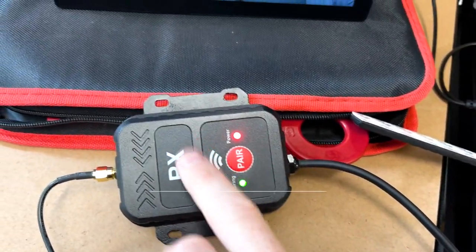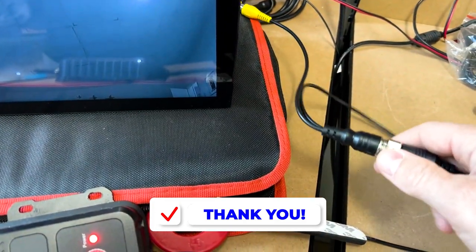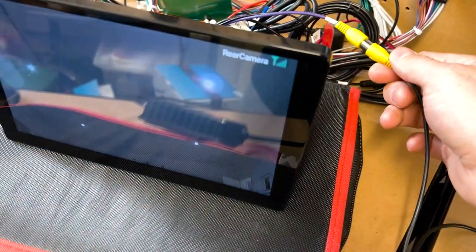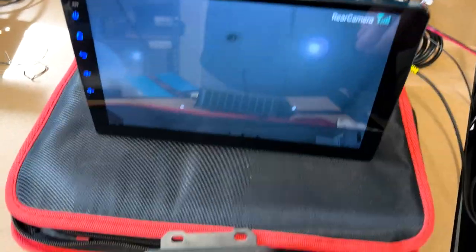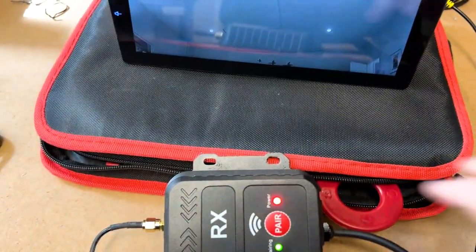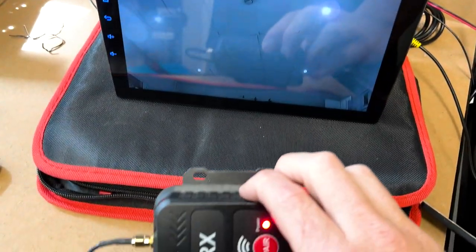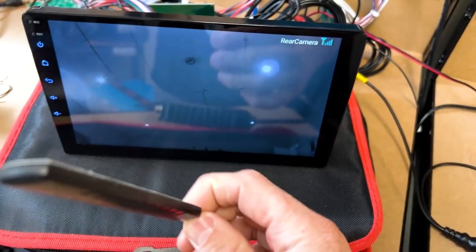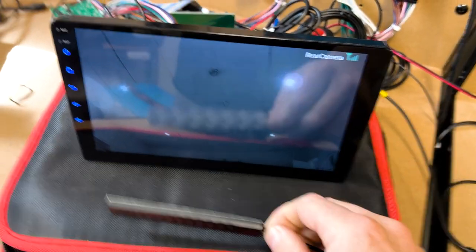So this is a connected wireless receiver. It's just plugged into our head unit here. It runs a four-pin cable that's been adapted to RCA, so we'll need an adapter if it's coming to one of our head units. We're just using the flat antenna here. Ideally you'd probably mount this behind the dash somewhere, and then run this up and stick it on the top corner of the windscreen to give you good reception — so 3M tape on there.